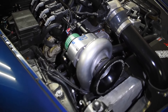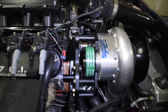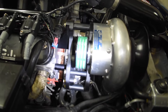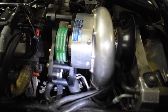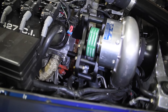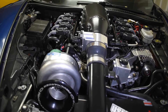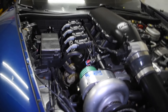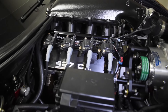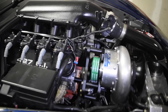Right now we're running just straight water for the cooling system, just until I make sure everything is 100 percent, because it looks like every time I'm going to have to take this supercharger off or swap out the belt I would also have to break loose that thermostat housing, and that will pretty much leak out the cooling. The highest our water temps got last night was about 171-172, which is pretty much the average. Usually when I do repeated hits I don't see higher than 185-ish.